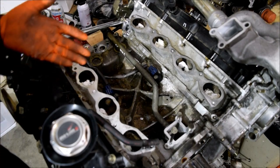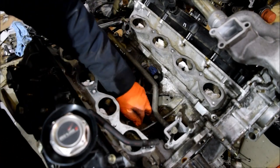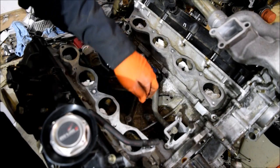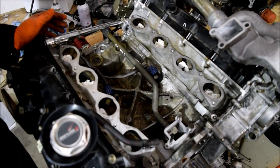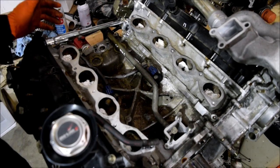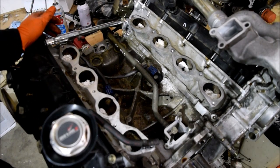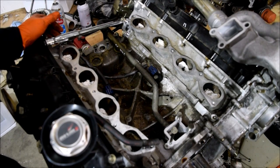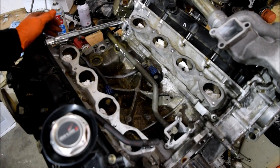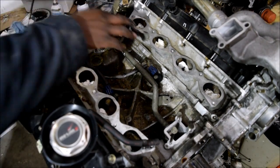Talking about knock sensors, some people usually talk about relocating their knock sensors. My opinion is don't do it. Putting your knock sensors anywhere other than what they were engineered to read will result in them getting false readings — good or bad, you might not be as protected as you should be. Knock sensors done, coolant tube down.